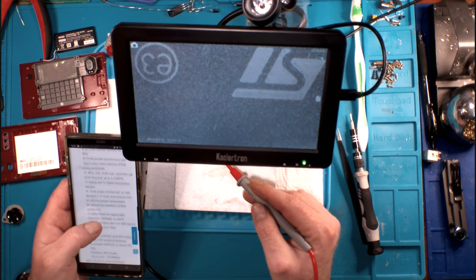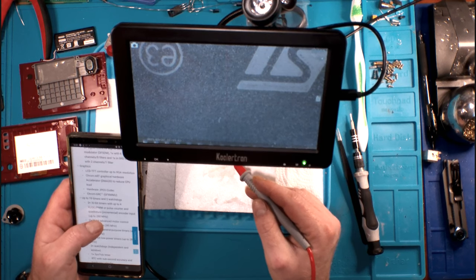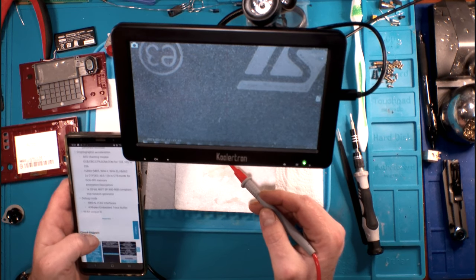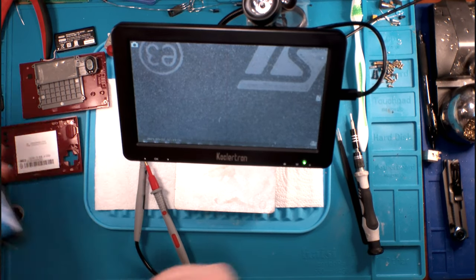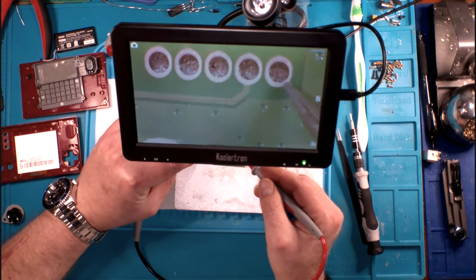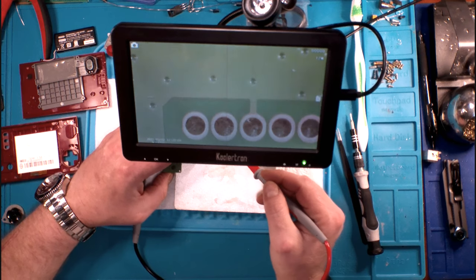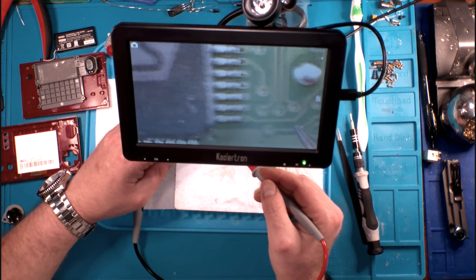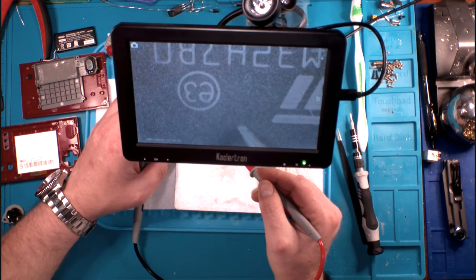It doesn't have any memory, but it will run a memory controller. So theoretically, it's also got graphics built into it to drive a TFT, which is how we're driving our display. It does have a debug mode as well. So it's got SWD and JTAG interfaces, which is exactly what I thought this right here was. I'd be willing to bet you that this is our JTAG right here, even though we only see a connection on the one side. And this is only a dual layer board, I think. I don't see any other connection. But I'd be willing to bet you could JTAG into this chip easy and swap it out.